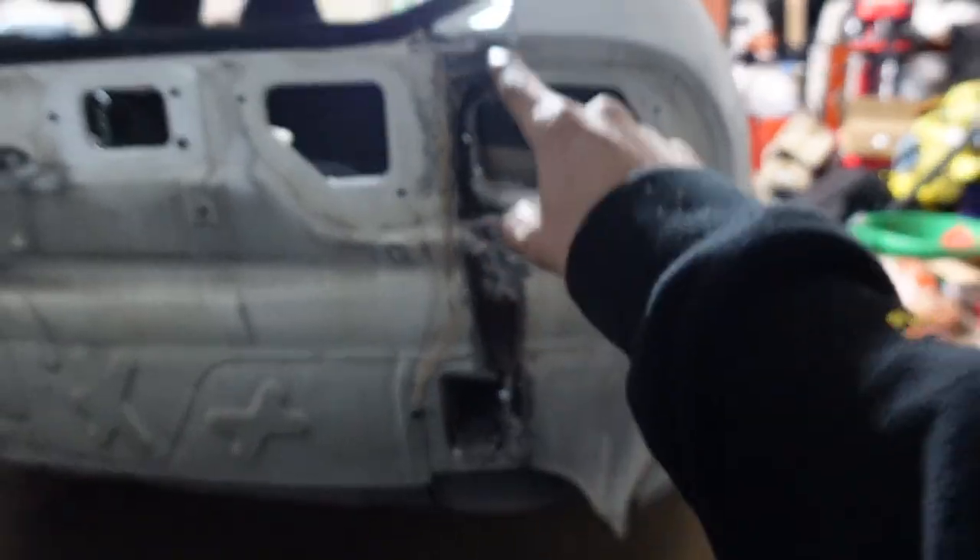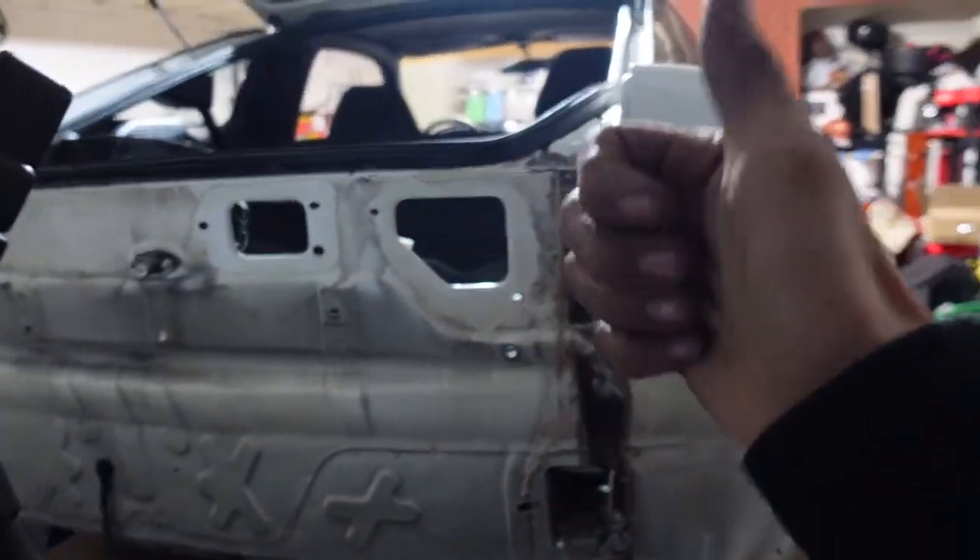So far so good. After this is done I'm gonna paint this area, throw everything back on, and put on the new tails. Usually everything on this car is a pain to do but everything today is going pretty smooth. The rust wasn't crazy — I was really hoping it was just a small strip like this. I've seen some 240s where the whole rear end is just rusted out, so it's a good thing. Check your 240 or any 90s old Japanese car — check the rear. That's why you take off your fenders. If you don't catch the rust it's gonna spread throughout the car. That's why people call rust cancer.